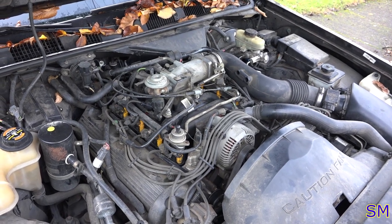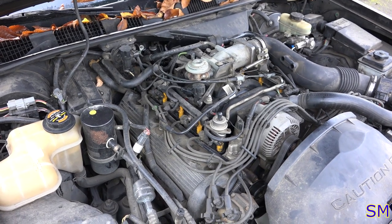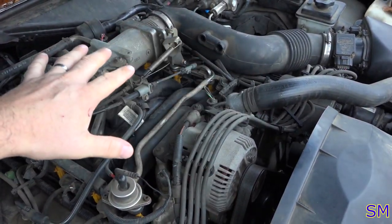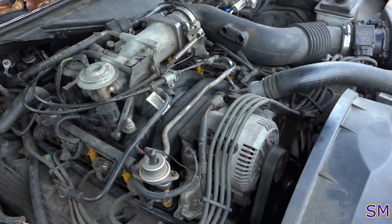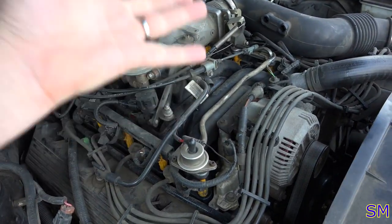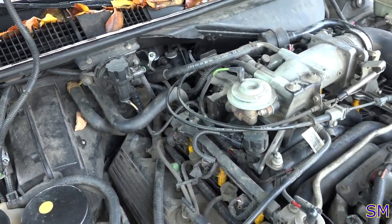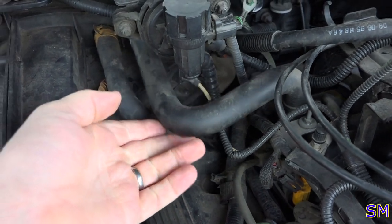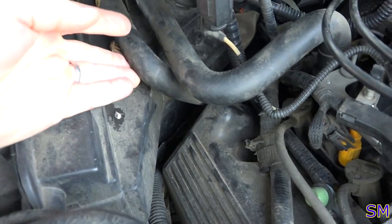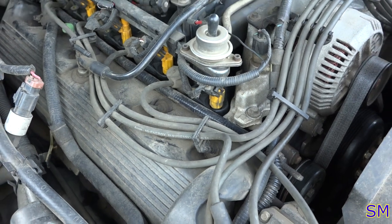Now, I have already diagnosed a problem. A customer brought this off camera, and I was able to quickly figure out what was going on. Originally, I could tuck my head right over the engine bay, and I could just smell the coolant wafting, rising up from the engine. You could just get that strong glycol smell. I'm like, okay, well, how about the heater hoses for the heater core, for the heater box? And I'm like, okay, no, those are fairly well intact. They check out visually. There was no water running down on the back side of the engine block. I'm like, okay, what else?